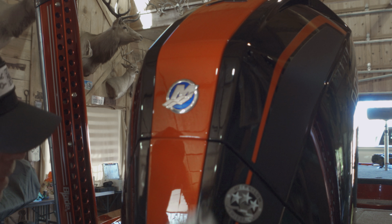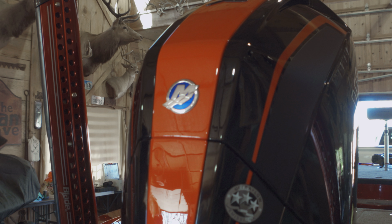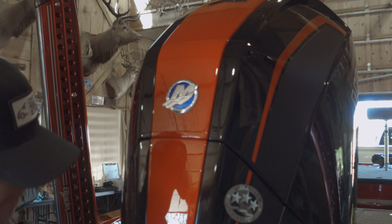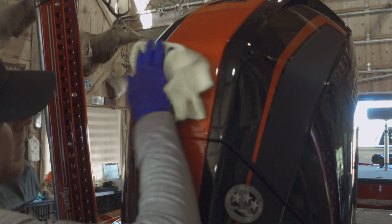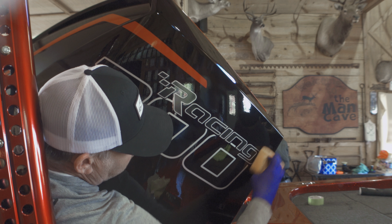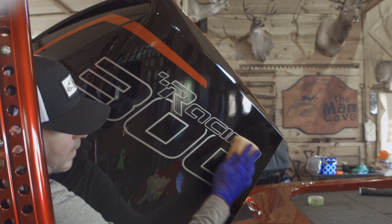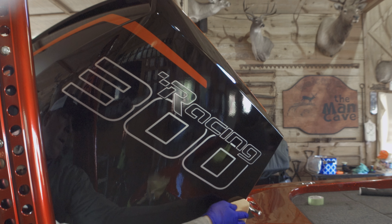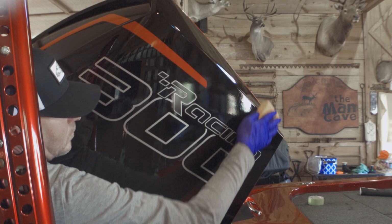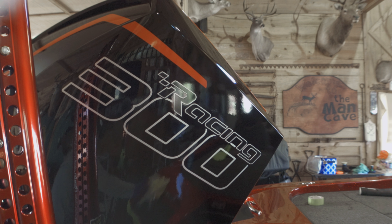And they just updated this, and it was good what they had before, but I think for user-wise, they improved it a little bit. It's got 70% SiO2 in it, which is the ceramic coating. This one flashes a little slower. It's still fast. I put it on and wipe it off right away, just so it doesn't harden. But this new formula flashes a little slower, has more ceramic in it. It takes about 12 to 15 hours to cure. So usually after 24 hours, you're safe to get it out on the water, but you want to wait about a week before you introduce any soaps and clean it in that way.